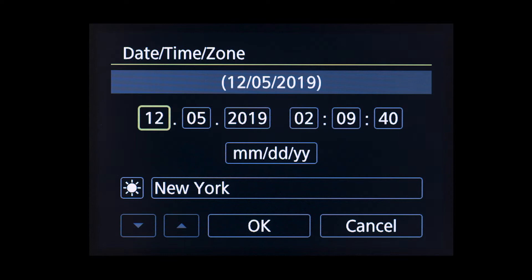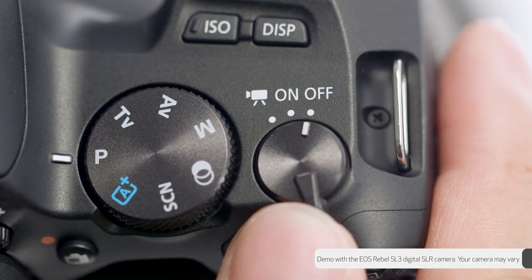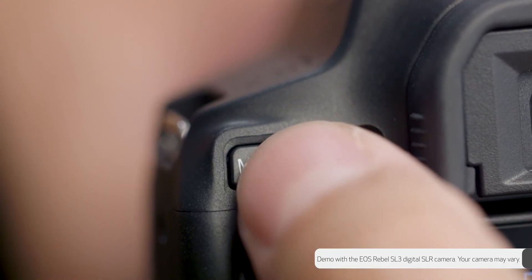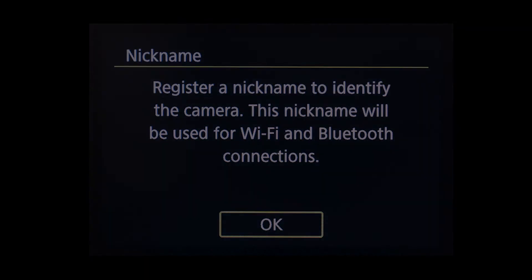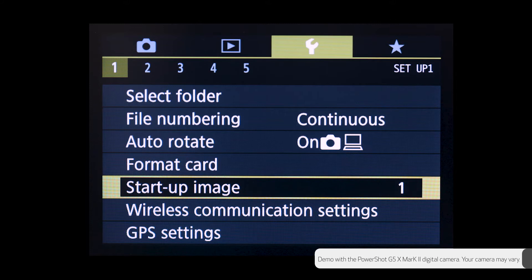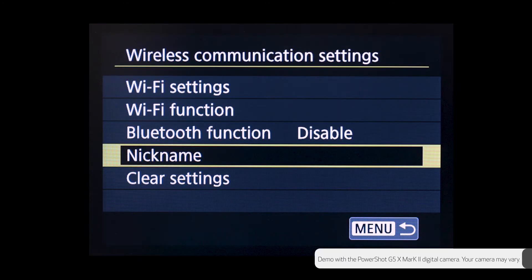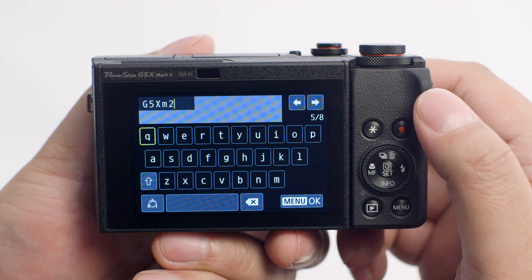Now let's connect your camera. Please make sure the camera's date and time are correctly set up and a memory card is inserted in the camera before proceeding. Next, make sure the camera is powered on and then press the menu button. When you set up a Bluetooth or wireless connection for the first time, camera models without the network tab will prompt you to enter a nickname. Setting up a nickname first will keep this part of the setup the same for all Bluetooth enabled cameras. Navigate to the Wireless Communications setting, then select Nickname. You may select the provided nickname or enter your own. This nickname will be used for the Bluetooth connection. From here, the connection steps may vary depending on the camera model.